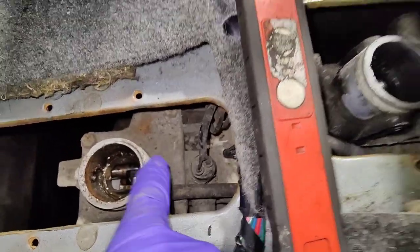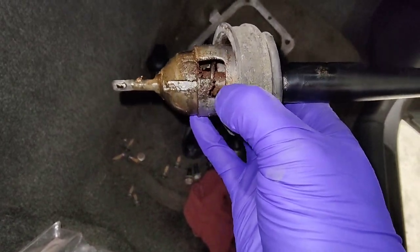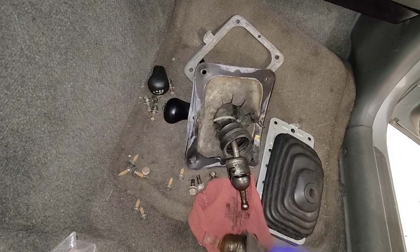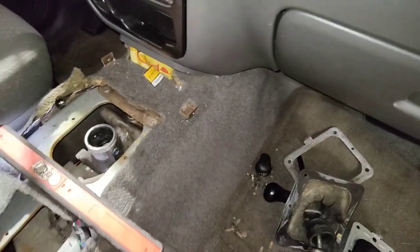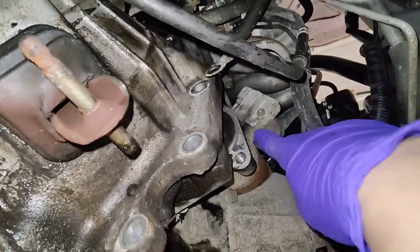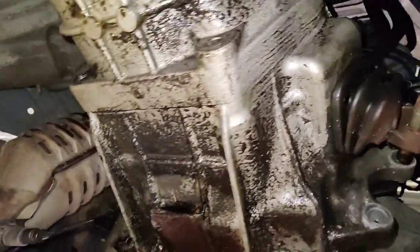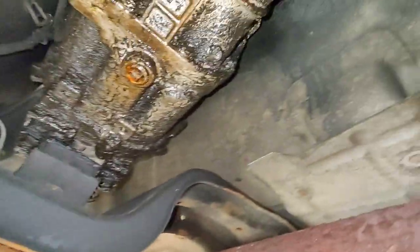There are two bolts on each side for the shifters, same thing on the back — they just go into a notch to hold the shifter down. It looks pretty rusty already so I'll probably clean that out. I already removed the upper bell housing bolts and the starter. There's one bolt way up there I had to feel by hand, and one on the other side you can't reach because the intake manifold's in the way. All I've got left is a couple bolts on the bottom and the crossmember.